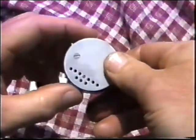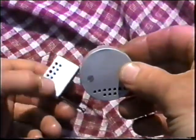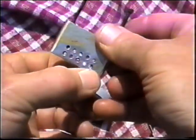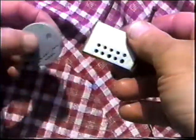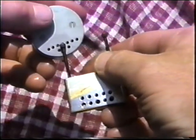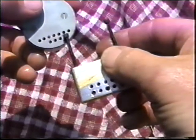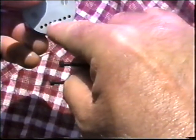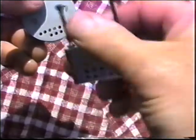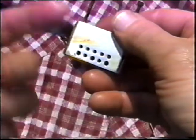See, now this would probably work if you were running a 10-6. But the way I'm running the motor really flat out, it really needs the extra holes. And even of the holes that we have here, the ones that are tapped out, you can see are considerably bigger. Now the way restriction works, if you add up the swept area in all these holes and made one big hole, you would have a lot better gas flow. As you make the holes smaller and smaller, for a given amount of swept area, you add wall area, and where you have restriction is in the walls. So what happens in a case like this? You just defeat the system by having so many holes that it doesn't matter.